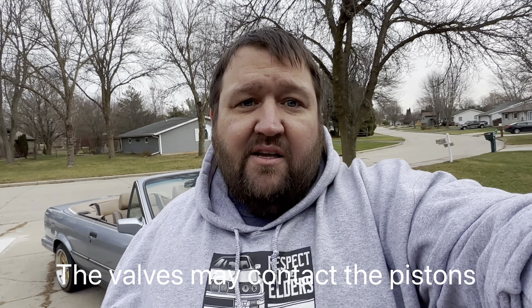M20s are quite readily available and pretty cheap, but it is far more of a pain to install an entire new engine than just changing your timing belt. On a company like FCP Euro, you can buy an entire timing belt kit for around $300, and if you have the tools it'll take three or four hours — or just two hours if you've done timing belts before. Next to rust, your timing belt is the second most important thing to look for on any prospective E30 purchase. However, that does not include the 318, as that came with a four-cylinder M42 engine which has a timing chain.